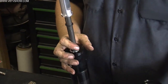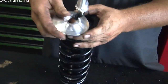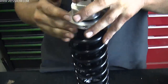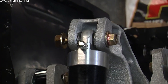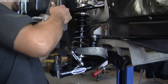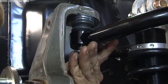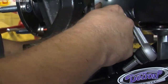I assembled the coilover shocks on the bench by slipping the retainer down, sliding the spring over it, putting the retainer back on, and screwing the adjuster up until the spring made contact with the retainer. These coilover shocks install into the upper mounts on the Alumiframe and then into the lower control arms. Once you've got the control arms hung on the car, you can install the spindles and torque the ball joints. The Detroit Speed Alumiframe system uses sixth-generation Corvette spindles, because everybody knows Corvette handles well straight from the factory.